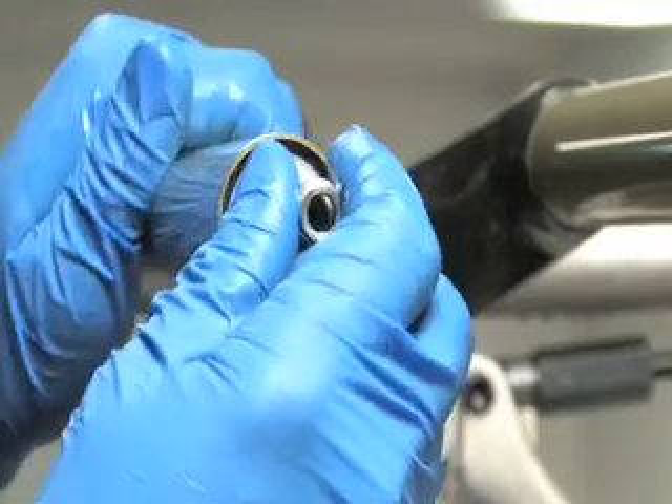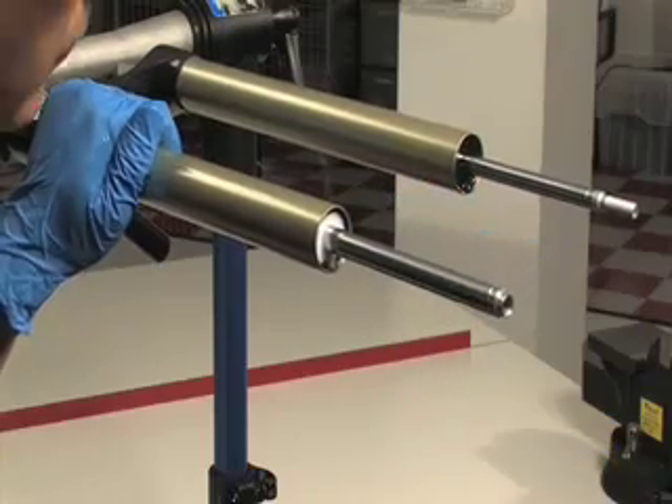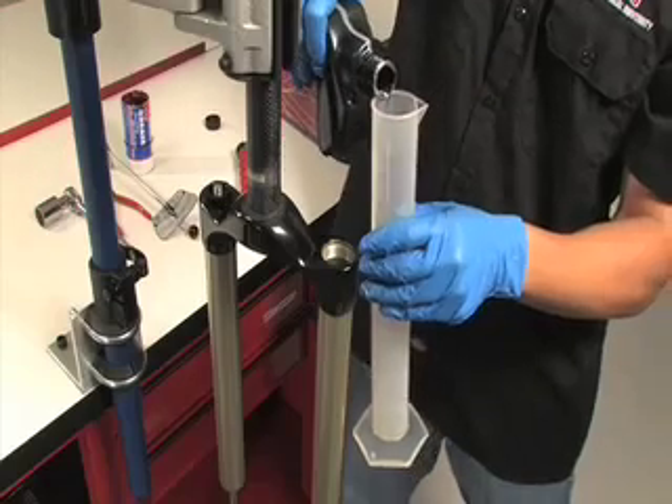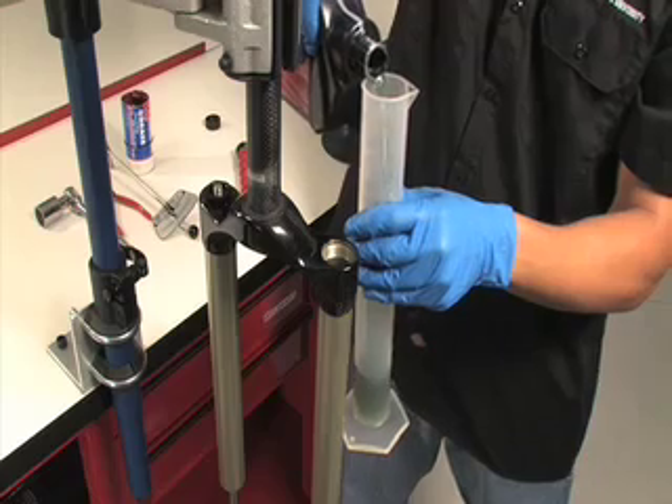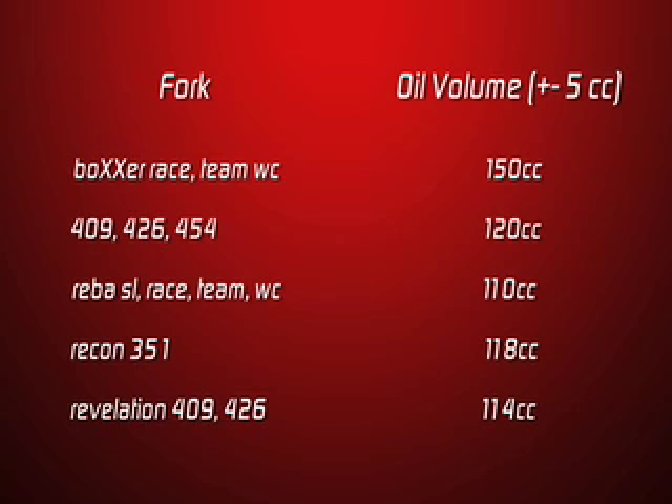You can check the retaining ring by using the snap ring pliers to rotate it in the groove back and forth a few degrees. If it rotates easily, it's in. Pull the rebound damper shaft down into the fully extended position. Measure and pour 5-weight suspension oil into the upper tube through the crown using the volumes listed in the chart. Oil volume is critical — too much oil reduces available travel which can lead to fork damage from compression bottom out, and too little oil decreases damping performance.